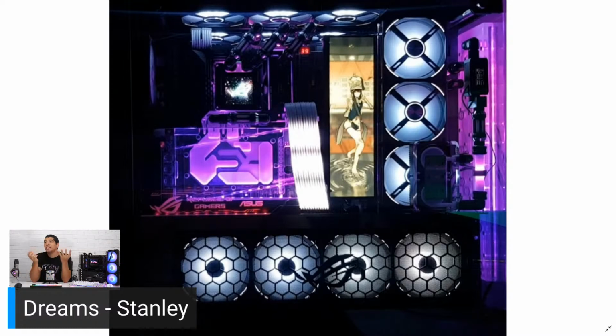So definitely more than you need, but the benefit with going with those large, big radiators is you've got a lot of that displacement there. So you should be able to pretty much run those fans at very, very low RPM. While you might think there's a lot of fans in there, this system should be almost effectively inaudible, extremely quiet. Although it is always a little bit of a challenge when you have very thick rads, with the amount of static pressure you need to push the airflow through. But natively with just good performing blocks and good flow, you should be able to get some good thermal dissipation in place.